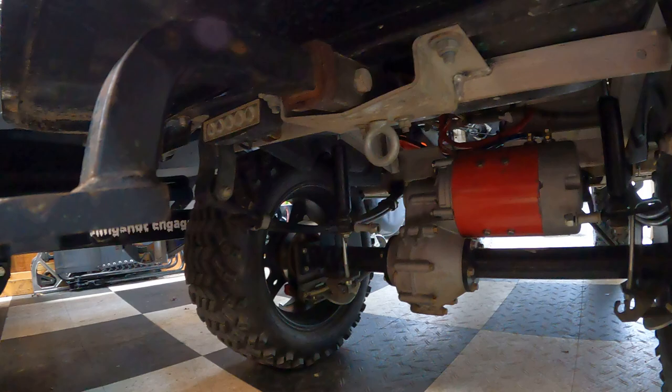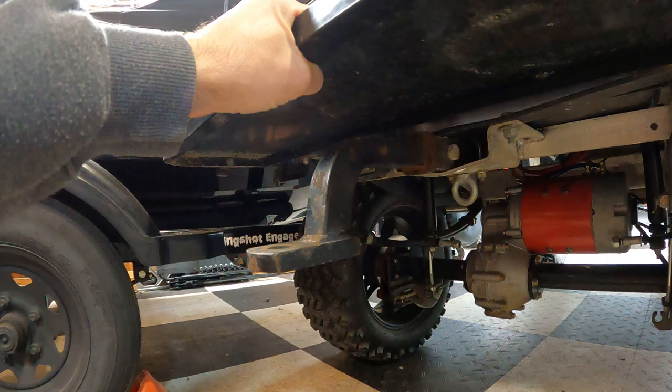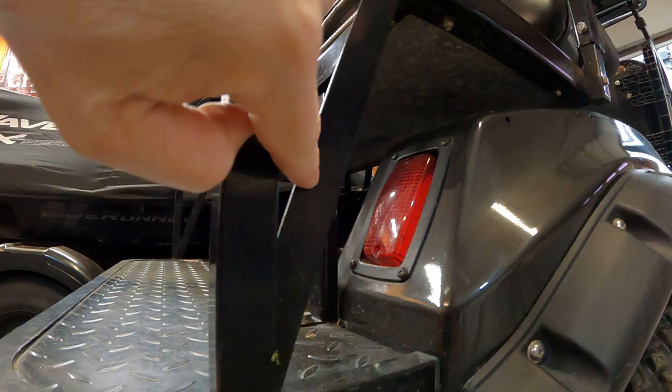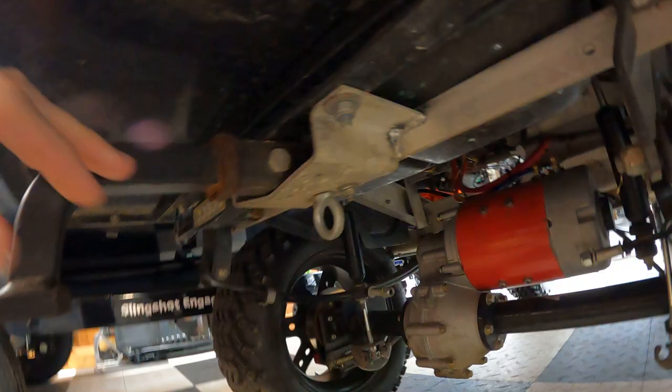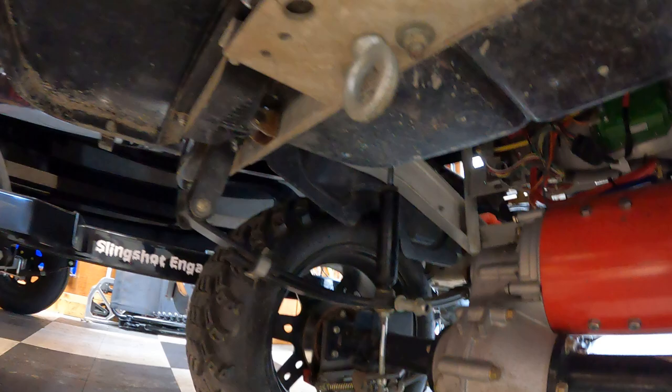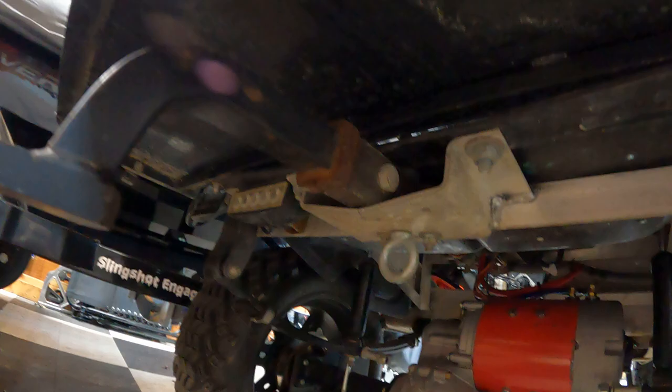A lot of people ask me about my hitch design. My dad's hitch mounts off this frame section, which isn't really reinforced too much, so I took some strapping and ran it from here down to here, which helped immensely. For the hitch, me and my buddy came up with putting a thick piece of metal across here, tied it into the frame, and I used a U-clamp inside to hold it in place. It does better than a hitch mounted off the step in the back — just country-fabricated, I guess.